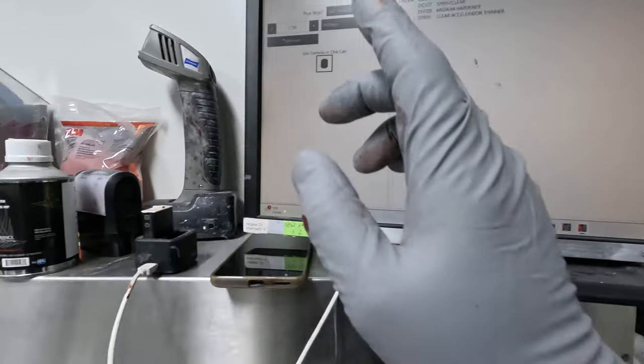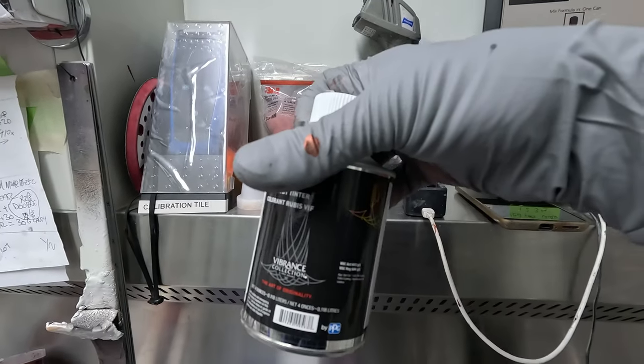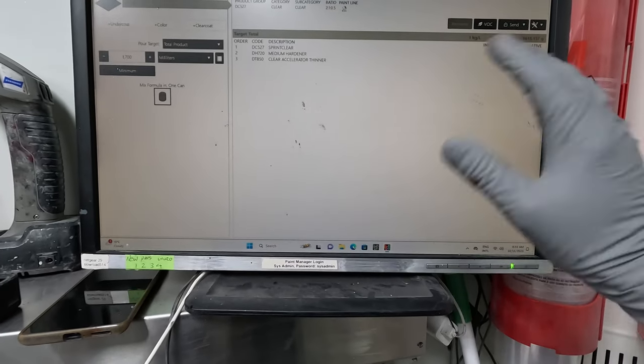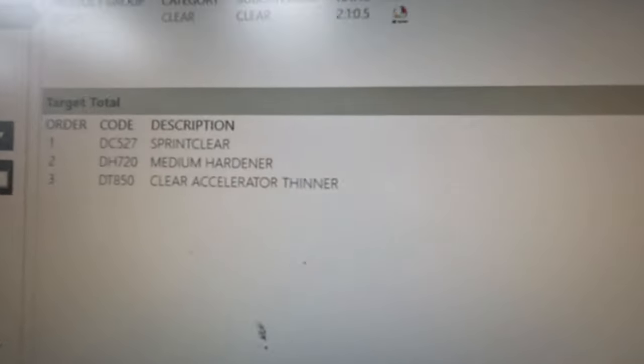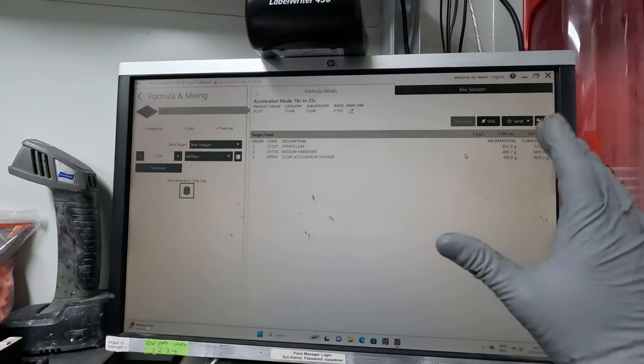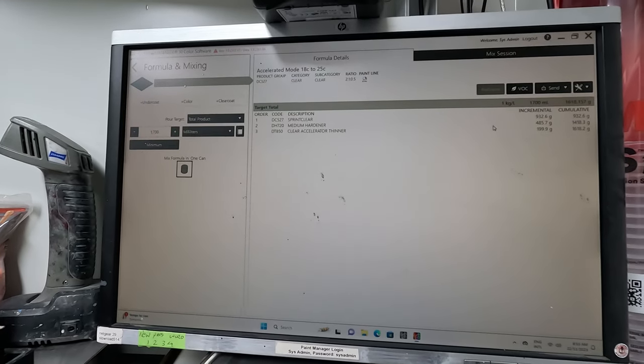And then add, like I said, 40 grams per liter. So, you know, you can sort of figure that out, 1.7. You'll figure that out with some basic formula in your own head. But yeah, that is the most important part. Add double thinners to the candy stage.